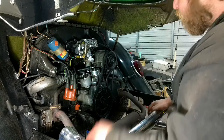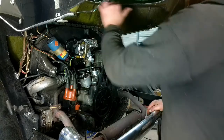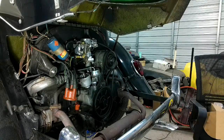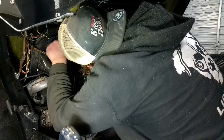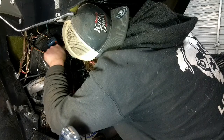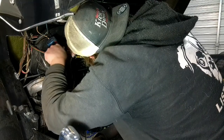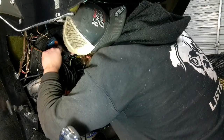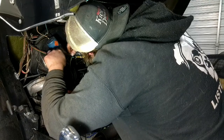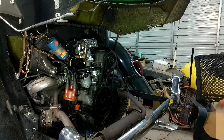Carb installs quick and easy. We'll do a pre-adjustment on that just for fire-up purposes. Run the screw all the way in — it's the little screw on the bottom — so it's seated. You don't want to crank it down. And what I do is one, two, two and a half turns out for right now.